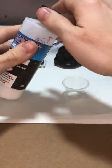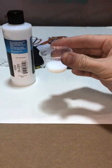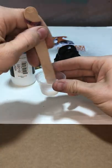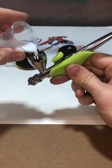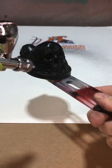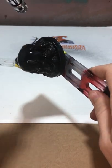Now that both parts are ready, you will want to protect the water-based paints with some 4050 before applying any 2K clear. This ensures no reactions between the two very different products. I grabbed the Grex TG3 with a fan cap for easy coverage and clear application. One or two coats will be all that's needed.